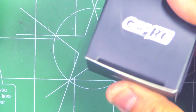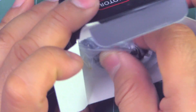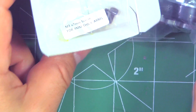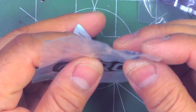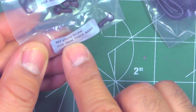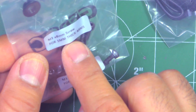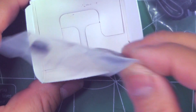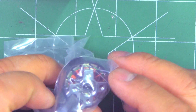They come in a standard box — nothing fancy, just a regular box. And they come in just a sealed plastic bag. They give you some screws and a low profile nylon. The screws are labeled M3x7 for 4mm thick arms and M3x8 for 5mm thick arms, which is a nice touch to label the screws depending on the arms you're going to use.